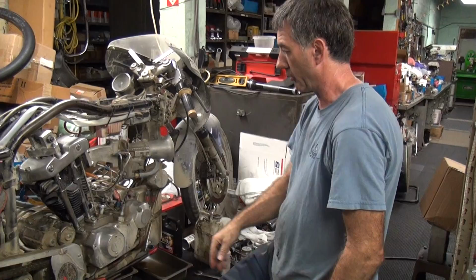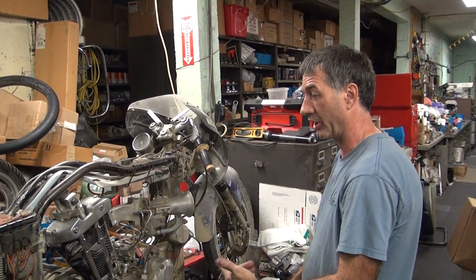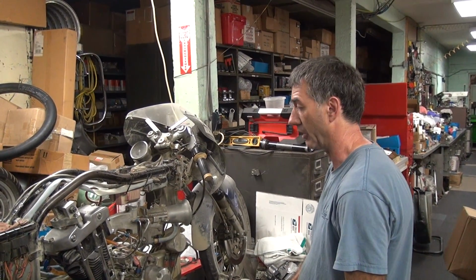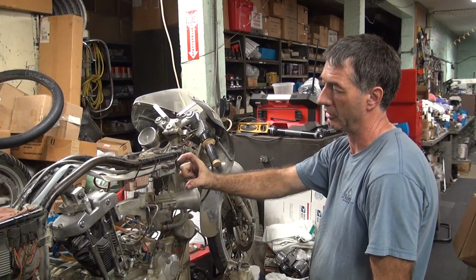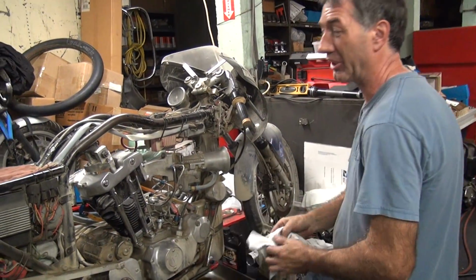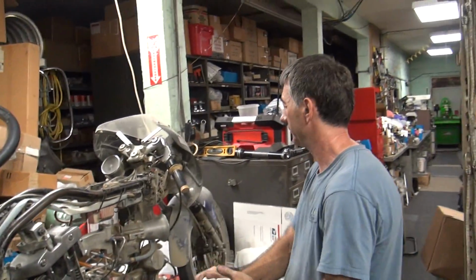But fuel is horsepower. If it keeps burning, you'll make more power, because the nitro and the nitrous have oxygen in them. The more you put in it, the faster you go. That's all there is to it. You just have to fire it. That's why I got that real hot ignition in here to fire off just about anything. It'll put out a nice spark about that long. It actually does multiple sparks. At cranking speed, about 7 of them come out. There's videos of that going.